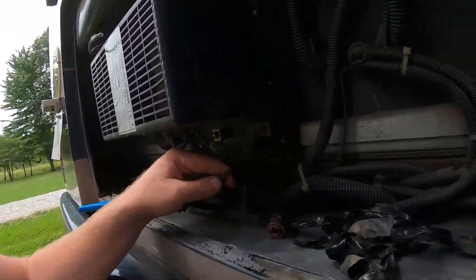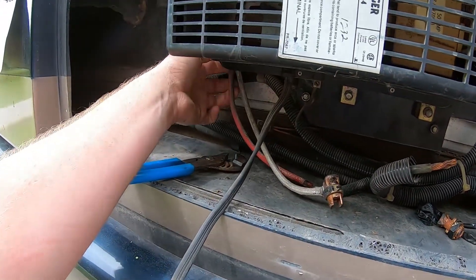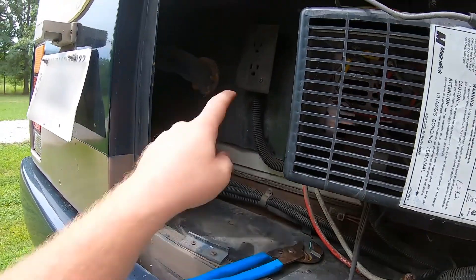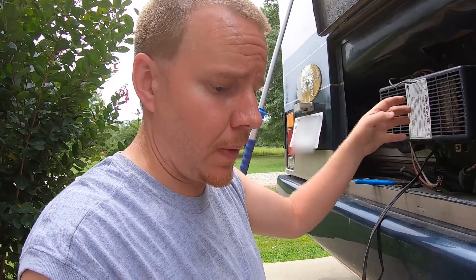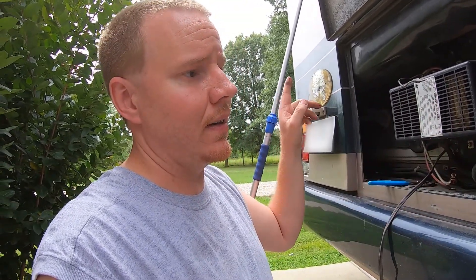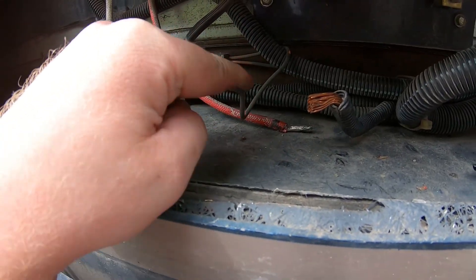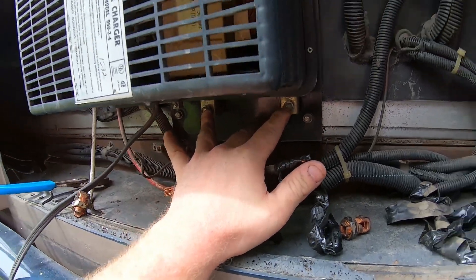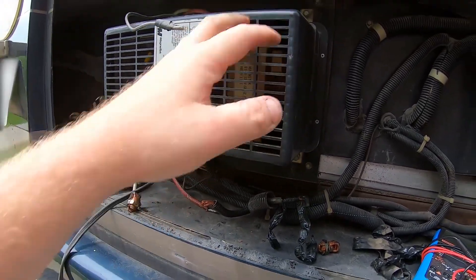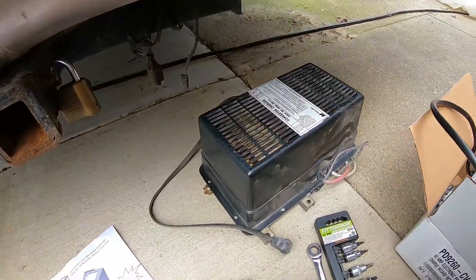I've got our batteries disconnected up front already, just disconnecting back here now. This should be pretty straightforward. This here is the positive coming from the battery bank, negative here. All that goes into this thing is the feeds from the battery and the plug-in for when it's on shore power — running from the generator or something. It feeds the battery bank which then feeds the fuse panel. I've got the ground disconnected and the mounting bolts loosened up, so all that's left is to take these bolts out completely and drop this big unit off the mounting. Got the old Magnetek out.